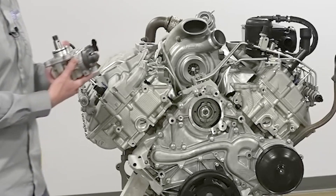That was the best thing available for a lot of years, up until the last couple of years when we've been working on co-development with Stanadyne Pure Power, who identified a different high pressure pump base we could use. The Ford is unique in that it's a V8, and the valley of the V where the pump is located is pretty tight. On an LML Duramax, for example, we've had CP3 conversion kits out there for years — getting rid of the CP4 and converting to a CP3 base pump — but that's a larger pump. It'll fit in a Duramax but it doesn't fit in a Ford. So there hasn't been a solution for the Fords for years purely because there hasn't been room for anything other than a CP4, since it's very compact.